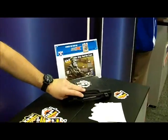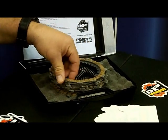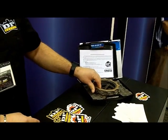What's nice about the kit is it comes in the case — everything together: friction, steel, and spring plates — no pre-soak needed, so you can put that plate right in the bike. That's going to save the mechanic time, it's going to save the rider time. If he's competing between motos, you don't have to worry about your plates being pre-soaked.